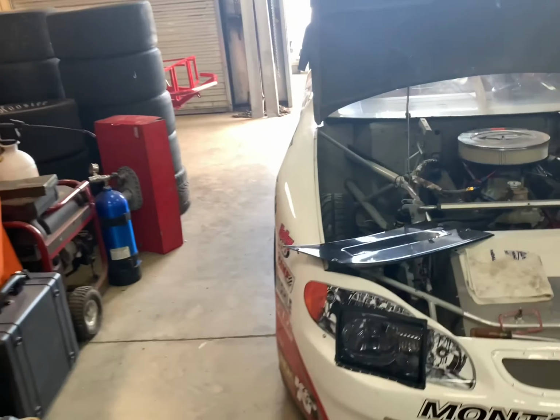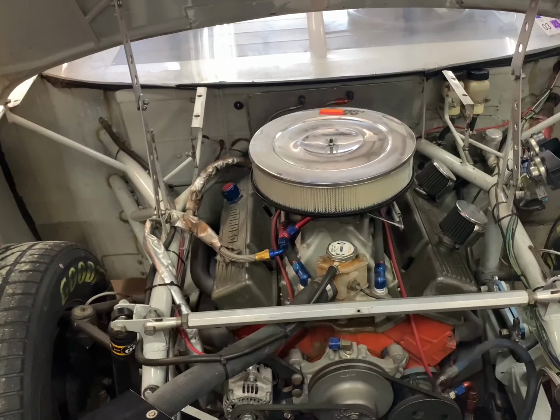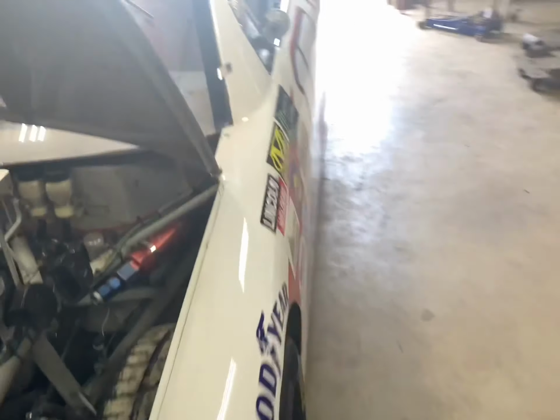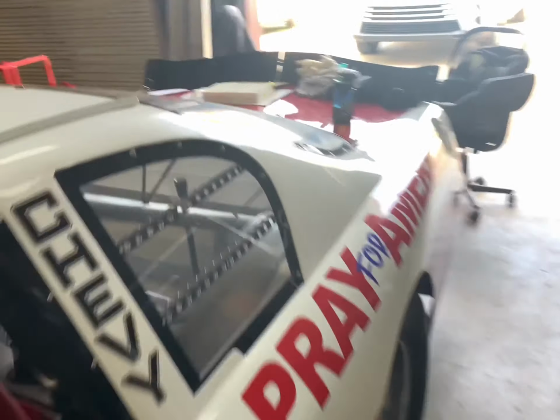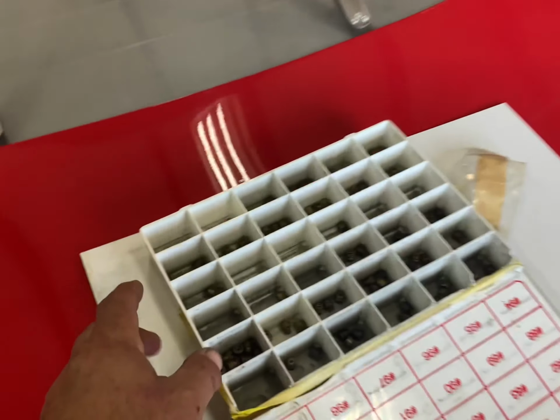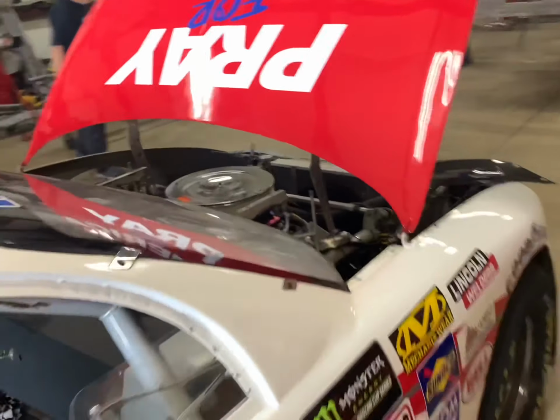Anyway, as I was saying there in the opening, the car fouled a spark plug, so we've gone through the jet box, and we've actually lowered the jet size in the front and the rear metering blocks here on the carburetor. We did a little adjustment on the carburetor, so we're going to put her back together now.